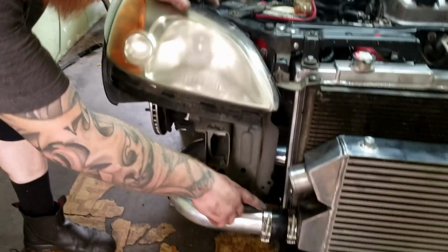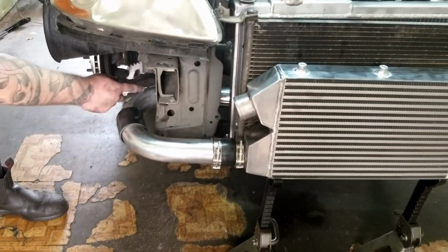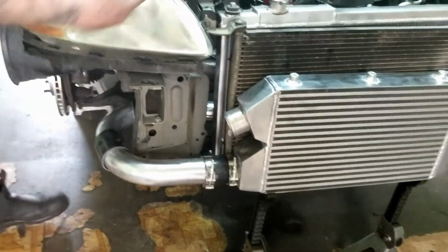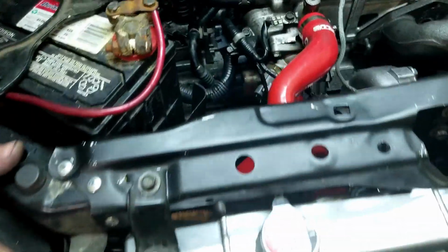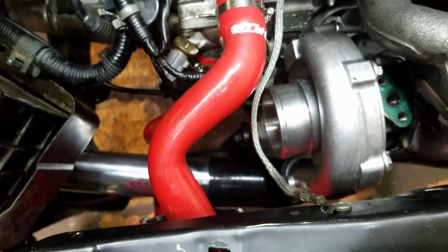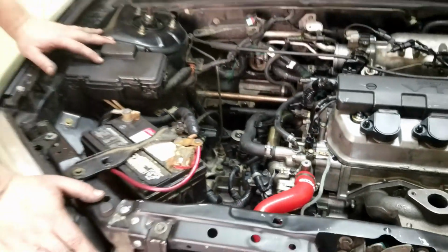Okay, so I took this pipe, I cut it, I used another piece to get the radius we need, and then I took a straight piece and cut it. So one charge pipe is done. Yeah, we should be good for one. So we just got to build one more.